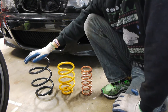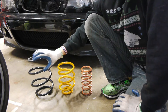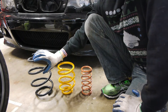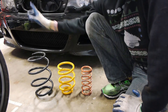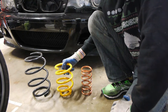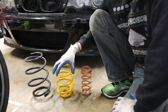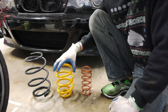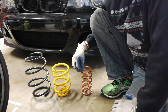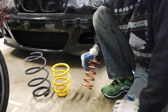At equilibrium the spring is compressed to support 750 pounds. At 150 pounds per inch, you're going to have to compress that spring about five inches to support 750 pounds on a corner. At 400 pounds per inch, this spring will only be compressed about 1.8 to 1.9 — just under two inches — to support that weight. At 325 pounds per inch, this one will be compressed a little over two to maybe 2.5 inches.